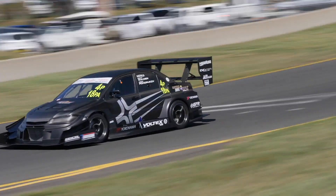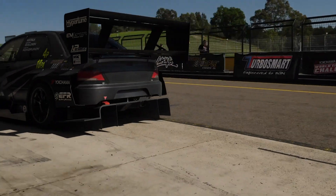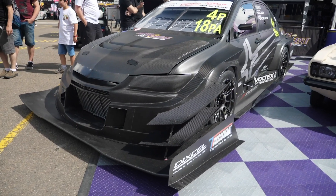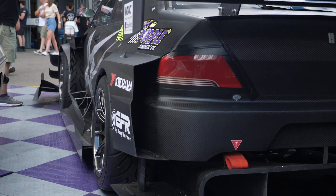Another way you can make use of damper potentiometer data is by estimating ride height at different points on track. If you know the relationship between your front splitter and the chassis and how that relates to the suspension, you can create a simple math channel that would show you splitter height at each point on track. In cars with really effective aero floors — like a large front splitter with a diffuser — the proximity from the splitter to the ground is a critical component in tuning aero behaviour. If you can calculate the ride height of the splitter above the track at each point on the circuit, it is really useful when tuning your downforce and diagnosing handling problems caused when the splitter gets too close to the ground under braking.